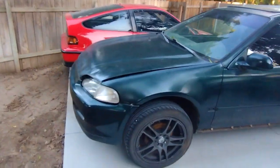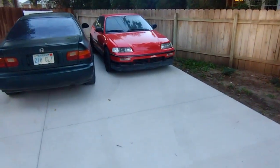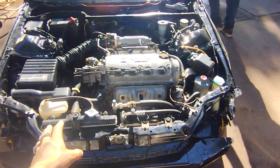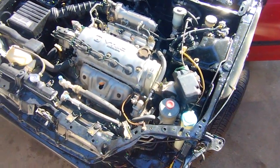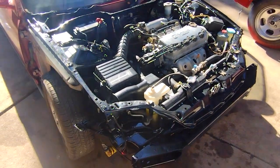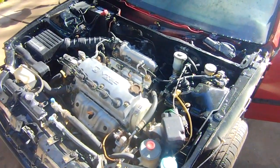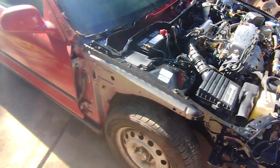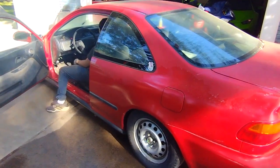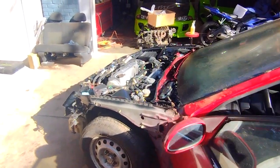We used a little tractor to move over to this spot — a garage is being built here, the concrete was just cut and they're adding a carport with sheets on the sides. He put the fluid in and let it run to make sure the fans kick on, AC works, and everything runs. It starts up fine, idle drops down like it's supposed to, hits 175–180 degrees and the fans turn on. It doesn't sound bad — and that's on stock headers.